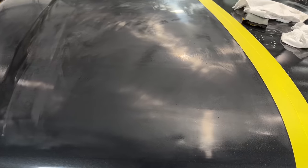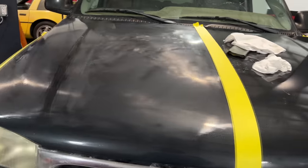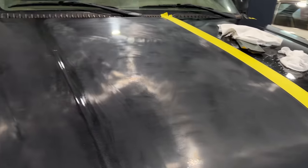About 10-15 minutes later, this is what we have. Some areas are a bit more sanded than others — some areas are more or less flat while adjacent spots are sanded less. This isn't going to be an exact science when you're trying to keep some of the orange peel, but once you compound and polish it they'll blend together and it will look much better.